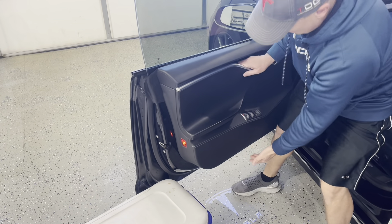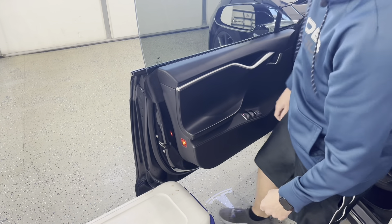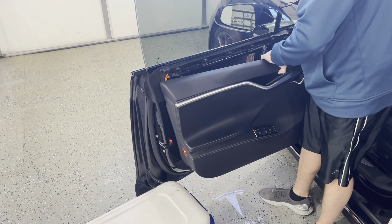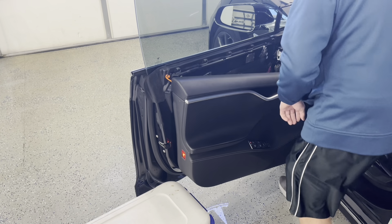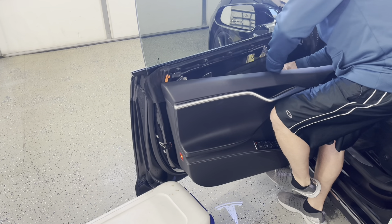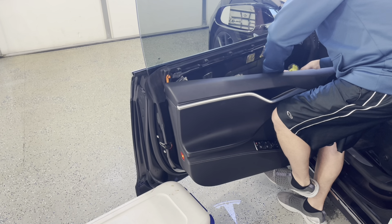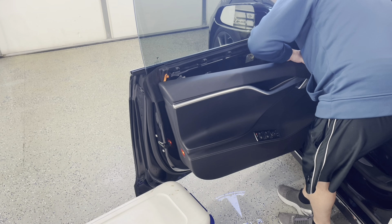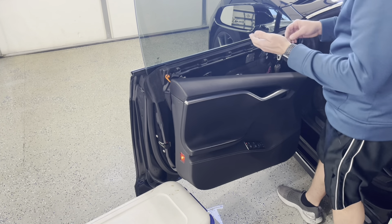You want something to rest the door panel on — there's going to be a little safety strap holding the door panel. Pull the panel off; it's just held on by clips. It just pops off. Get your T25 out. Instead of taking the cable off the door latch, I'm just unscrewing the entire door handle mechanism.